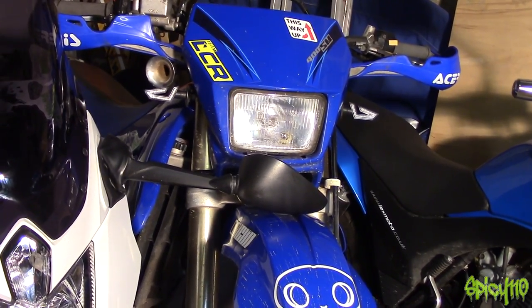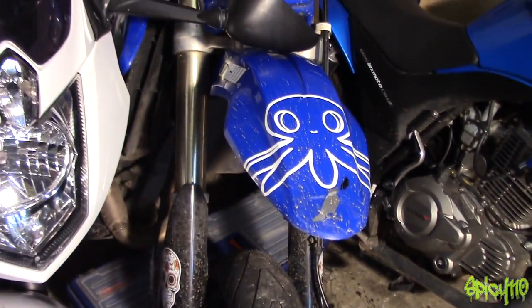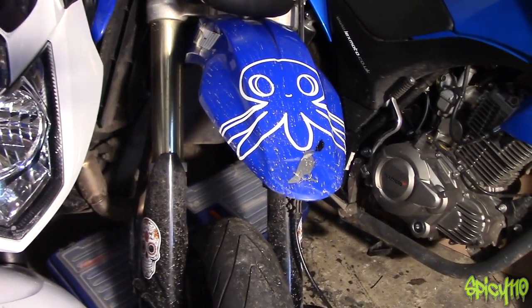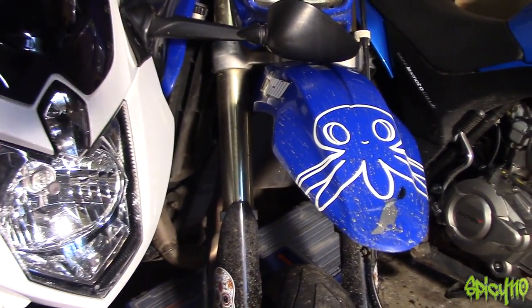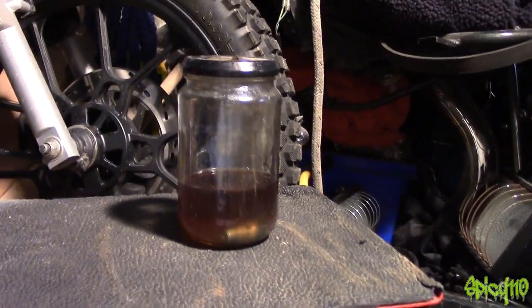You don't want a massive amount of braking force on the rear because there's no weight back there. One thing to be aware of with motorcycle braking and physics: when you pull the front brake on, the weight of the bike transfers onto the front wheel, which compresses the suspension and pushes the tire into the road — that gives you extra braking force. On the rear you never get that effect; it's always just dragging.